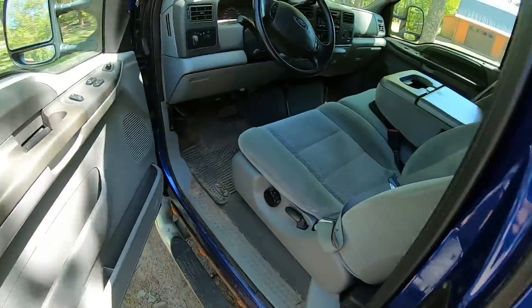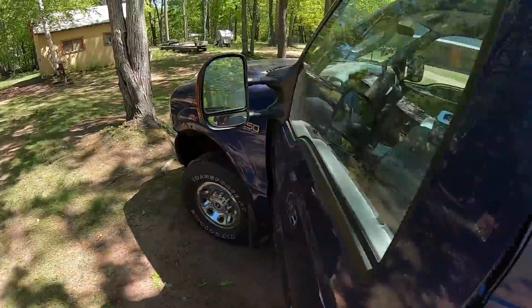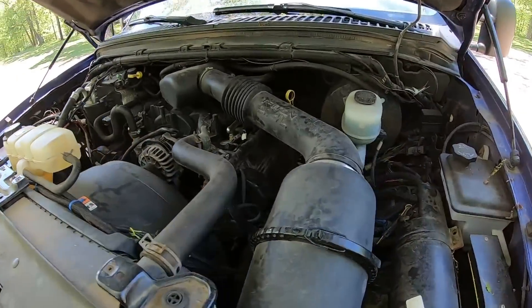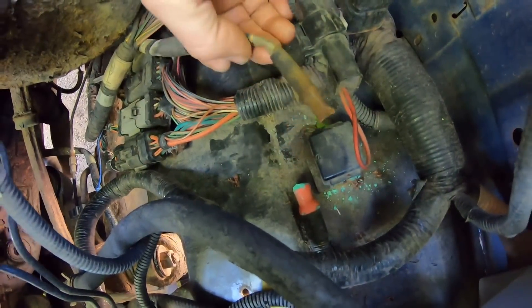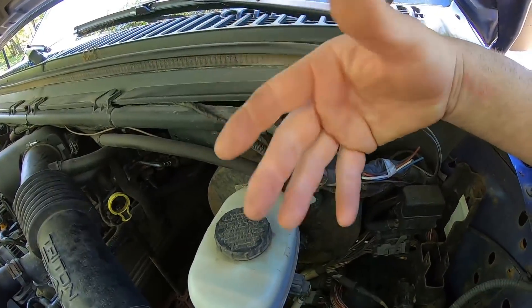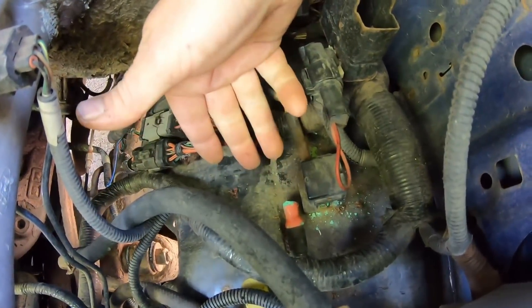But one more thing I need to address today before I can do anything else - Old Blue broke down. I went to leave for work the other morning, turned the key on, had a funny buzzing noise behind the dash, the lights flickered on, went off, and then it was dead. I pretty much knew what it was - popped the hood and it's a pretty common failure point on these vehicles in high corrosion states. This heavy power cable goes into this non-insulated, non-sealed junction block. There are some ring terminals that feed a double lead and then a fusible link in there, and that powers most everything behind the dash as well as the body control module, the GEM module - all the stuff that needs to be aware and sense things to make this thing decide to start and run. I've seen this fail before on other vehicles; it's only been green for about five years so I'm not sure why it quit on me now.